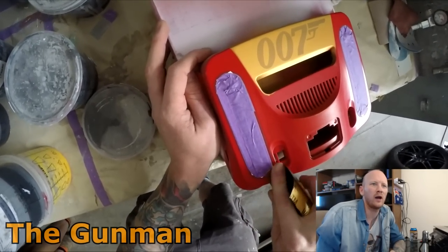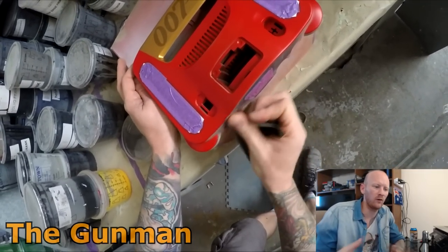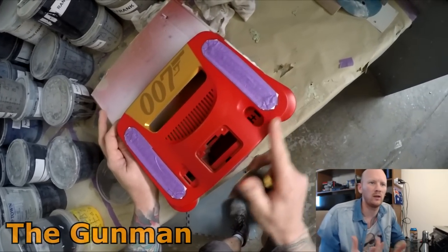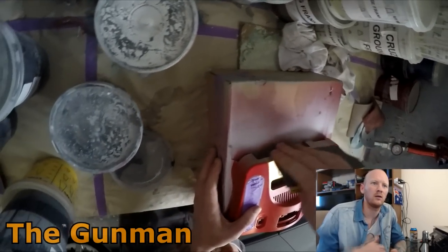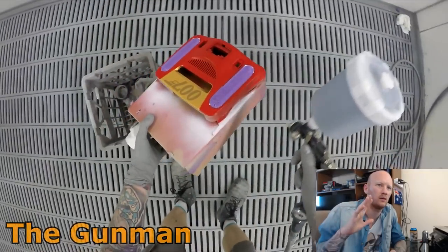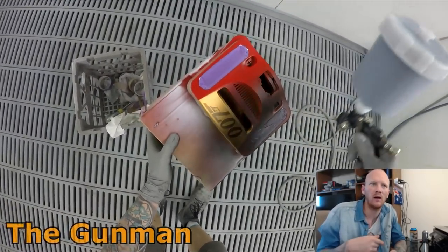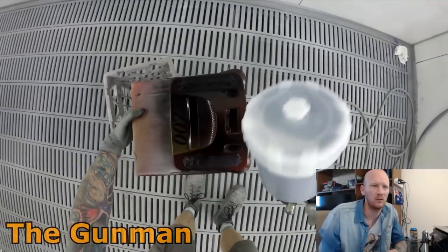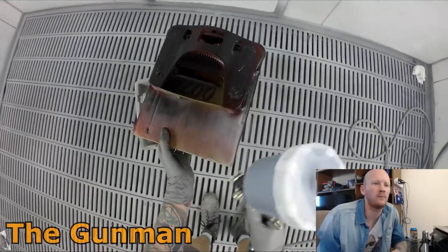They say you've got a 24-hour window between base coats, so if you put your base coat on, you've got 24 hours to re-clear it, and this is definitely within that time frame. So this was the Tuesday. I got the red and the gold down on the Monday night, came home, put the stencils on Tuesday morning, put the white down, then masked it back up, and I think this is around the lunch break time on the Tuesday. Or morning tea, something like that.